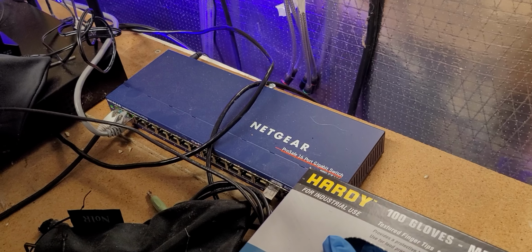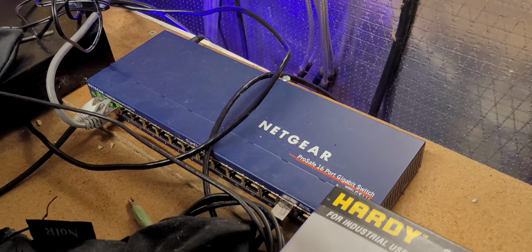Now, the other part of that is the fact that with iSCSI, you have to understand, your little 8-port hubs, you can only use 4 ports. That's right. So if you have two 8-port hubs, 1 gigabit hubs, they're cheap, which means they don't have an 8 gigabit bus on the back end. They kind of share resources. So don't do any more than 4 ports off of an 8-port. With that being said, there's also one kind of switch out there, and that is the following: the Netgear or common denominator 16-port switch.